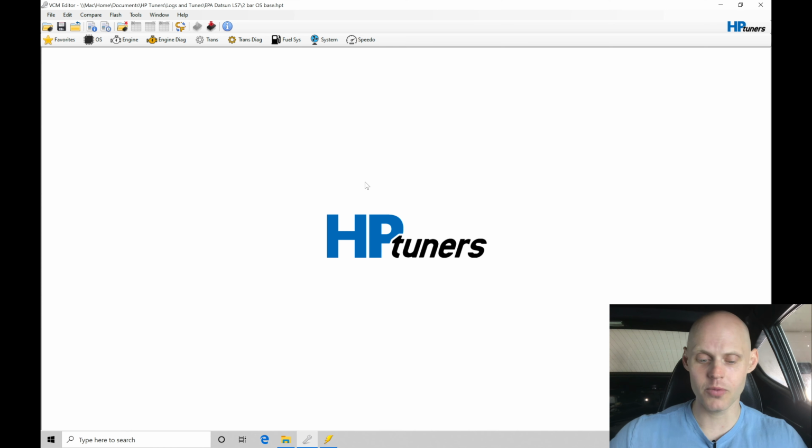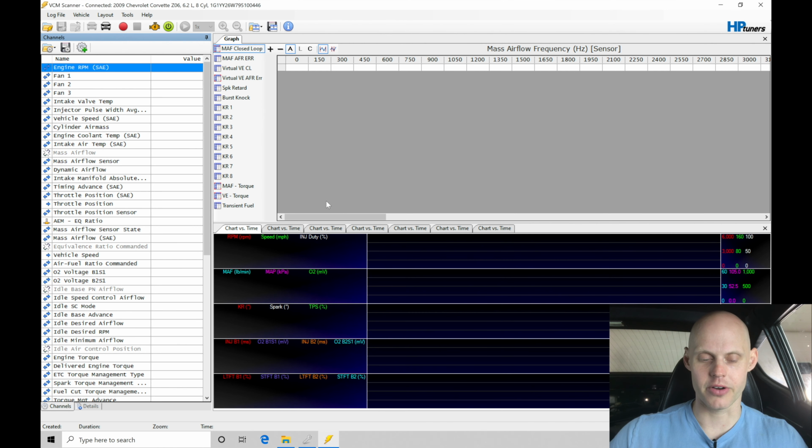So if we go into our VCM scanner here, I have it opened up. I have my channels list here that I'm going to be working with. Now, this particular channels list, we're going to be focusing in on working with idle control tuning and the mass airflow and getting that calibrated. It's not going to be taking a look at doing any kind of spark tuning or any kind of knock retard. We're going to be leaving that to a separate video.